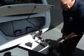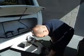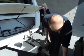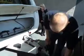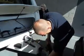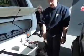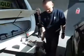Okay. So what we've got on this end, obviously, is your hitch. Obviously, we need to change your tow ball. The reason we need to do that, if you see this here, this overhangs the bottom of the hitch. Over a period of time, especially if you go through quite a tight turn, that starts grinding over the top of that and disturbing it. That can end up cracking, and you end up with a damaged hitch, which you don't want because they're expensive. Not necessarily that the hitch is going to come off the ball, but it's going to damage that.